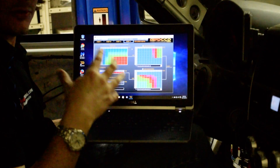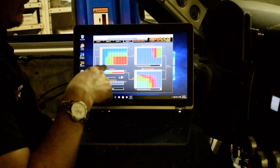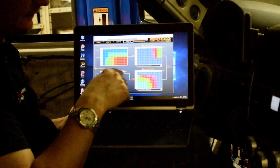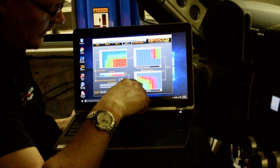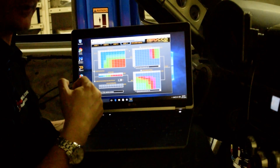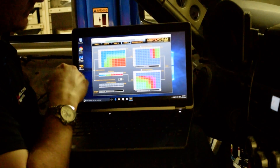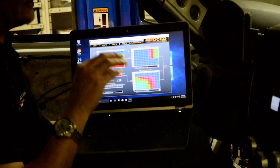This is where you can tune how the DCCD behaves. MAP DCCD has provided five different tables. One is throttle position, one is throttle position and speed, and you've also got brake mapping based on vehicle speed — so basically, if you hit the brakes, do you want the center diff to lock up? That runs into the braking modifier, which maps miles per hour versus what the accelerometer is seeing. You can also set up a left-foot braking map. The cells are actually similar to how you would tune load cells in the ECU — you put in how much lockup you want, and the center diff controller compiles all of these tables based on what you're doing and the driver input to control what the center diff does.